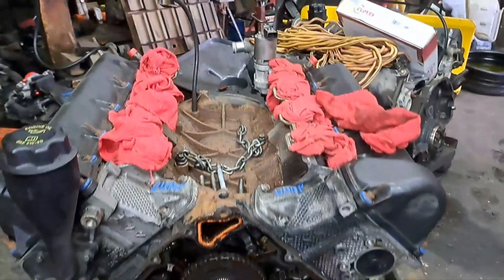There's a dot here and another dot there - I need to line those up. I'll look up my marks and print that out, then get these lined up. You can see there's an R here and some dots and holes. There are marks on the new chain that have indicators. I'm going to knock this plug out too so I can get to the bolt that holds the cassette tensioner in.